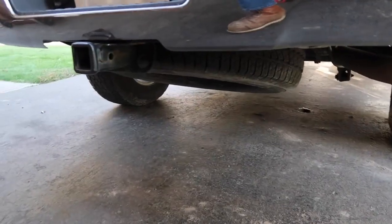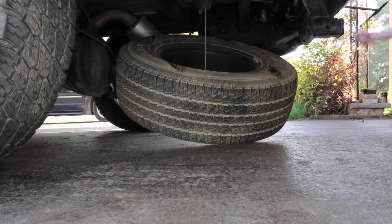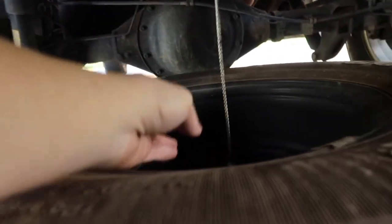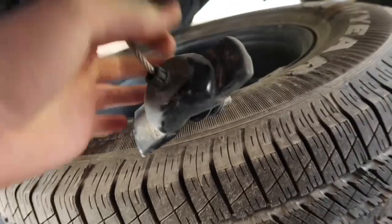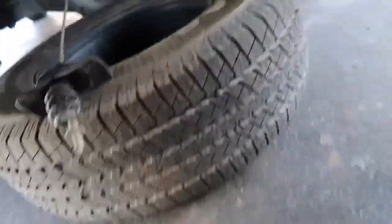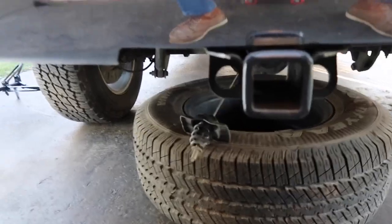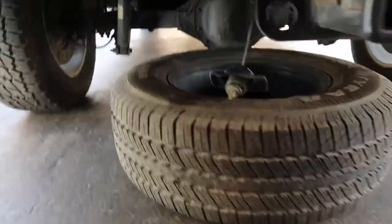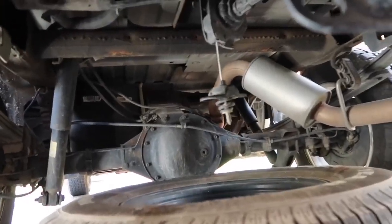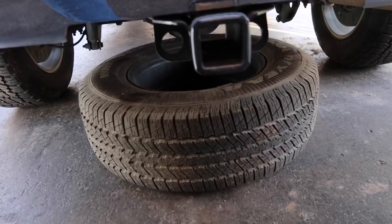As you can see, that brings the spare tire down. Now once it's all the way down, there's a cable right here — that thing on the end of it you just twist sideways and put it through the middle of the wheel and pull it up and then it's out. Now what we can do is go back to this and twist it all the way back up so it'll pull that cable back. Now the cable is all the way back up. We pull the tire out and then we'll go up under there to get the bolts out.